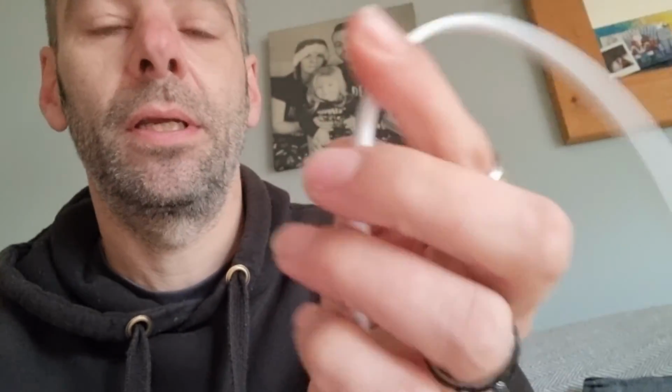So I am going to first connect, which side am I going, driver's side first. So I'll get the wires connected, get these two connected up together using these quick locks. And then I'm going to put some heat shrink over the top. And then I need to measure from one fog light to the other. And I will then make a cut in the outer casing so that I can connect the other side using quick locks onto that. So it's one piece of wire.